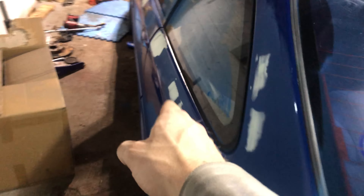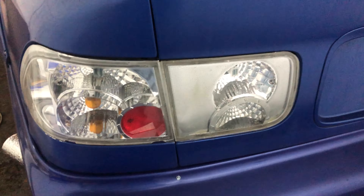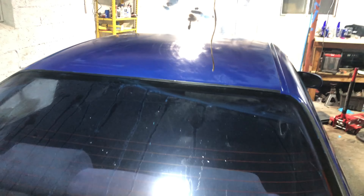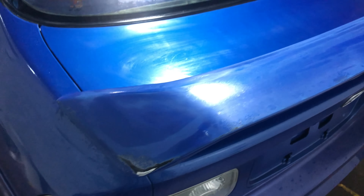I'm honestly kind of lucky — it's a $500 car with some random parts I got off friends, some free, some paid, but not a lot of money in the end. There's not a whole lot of body issues: those two dents, the little ones on the door — oh shoot, I forgot to do that one — and the hood. Other than that I just gotta smooth out the paint and we'll be good for the next color. Got the roof and trunk sanded down partially — it's about 10 o'clock at night so I'm gonna end it. The roof is a lot smoother than it was. I'll do 600 right before I paint it.